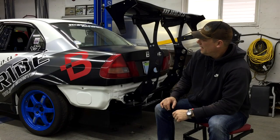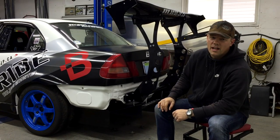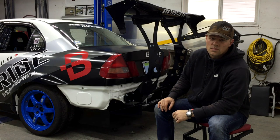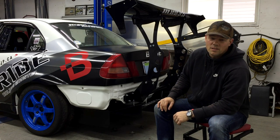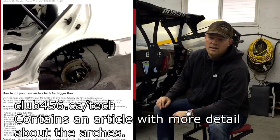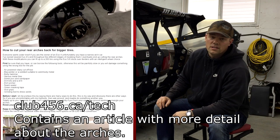Now at the back of the car, as you can see the flares have been added. Those are from Evolution 5 and Evolution 6. The flares had to be glued to the side of the car — you can use the stock clips as well if you want to drill holes in the body, but I opted to use an automotive-grade adhesive that's actually used to fasten fairings onto semi-trailers, so it's plenty strong for a small flare on a race car. With that flare you do have to cut back a little bit of the wheelhouse, and in that area we opted to spot weld the layers of steel back together and then reseal it so it won't have any vulnerability to corrosion.